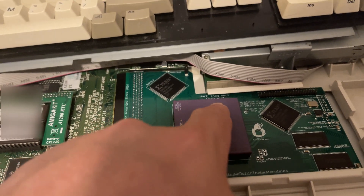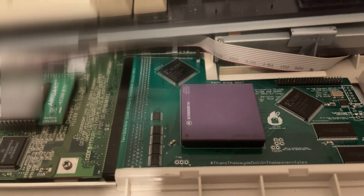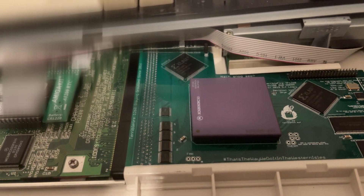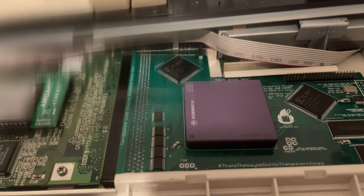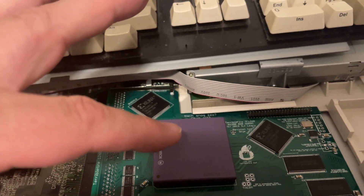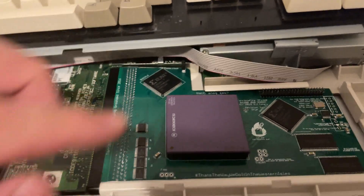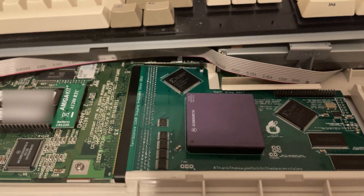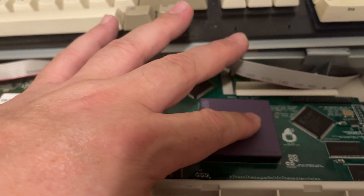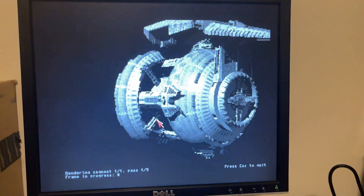It's a little warm but it's just started. What I'm thinking about doing is not a fan — there's not a lot of space — I'm thinking heat sink compound and then going to Home Depot and getting some aluminum and just doing a big conductor metal panel here. Heat sink compound and a piece of aluminum to help disperse the heat coming off of this. I'm not doing any overclocking — this is probably a 50 MHz chip, could probably do up to maybe 60 or 75 MHz, but even now it's warm but not cripplingly warm.